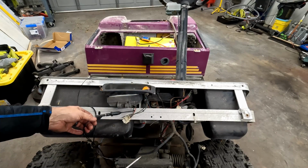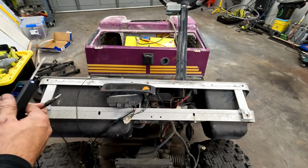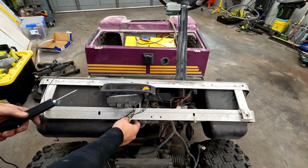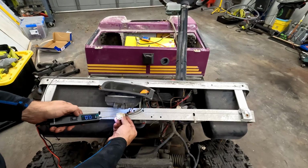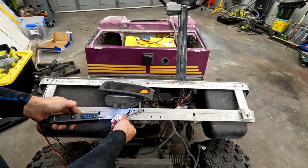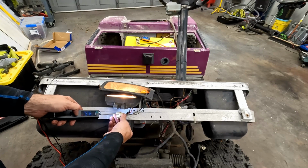So I've got a hookup here where I have a negative cable with a little pierce connection into the negative on this headlight, and I'm going to connect that to the negative cable on this tool, and that will make a circuit, and we'll probe here this red. So that's telling us we have continuity all the way through. That's good. That means the bulb isn't blown. Now we'll see if we can juice it up. There we go. Push forward to the 1, and we've got a working headlight.